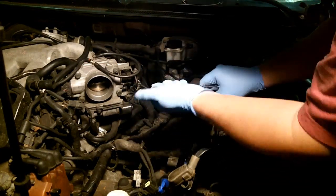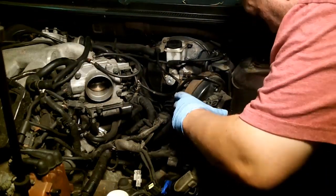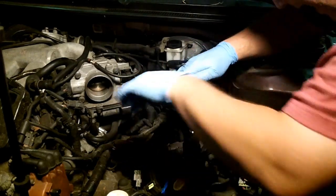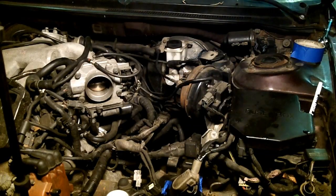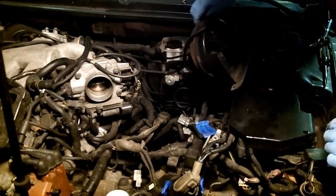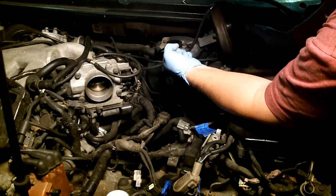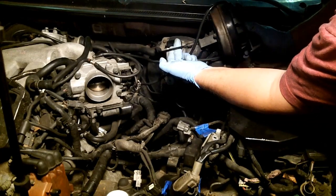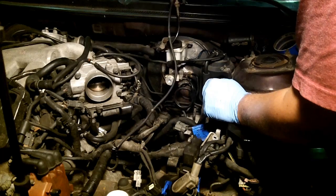Next I'm going to get these headlight relays out of the way. We're going to get that bracket off so we can get the transmission up past here. Cruise control bracket — I wonder if that's going to be another 10mm. It is. That whole thing should come off — disconnect that, label that, and just label this 'cruise'. This is attached to a cable actuator. This cable here is the other cable on top of your gas pedal. If you have cruise control capability, you will have another cable attached to your accelerator pedal — one is your accelerator cable, the other is for cruise control.